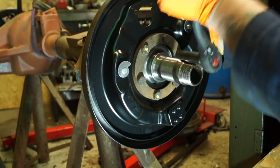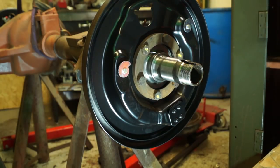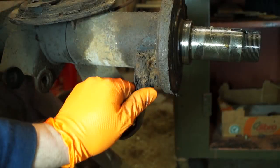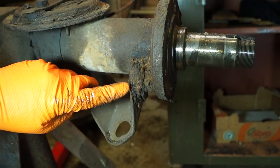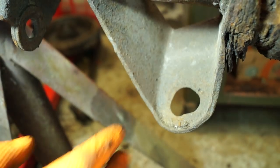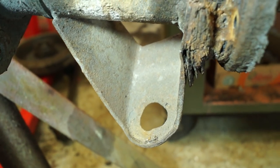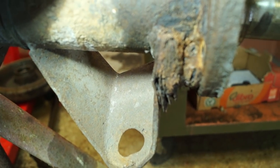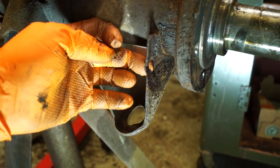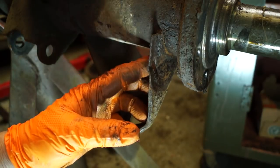You can see I've marked them — just pull them up, nip them up, and then torque them up. What you'll see is what has been shaved off as it's been pulled onto the stub axle. We didn't get away very lightly here because there's puff-pastry rust and mud crammed up in this aperture. The shock absorber mount is worn so that will need replacing, and it looks like it's rotted right the way through the bracket. After I cleaned it up — yes, there you go, it's rotted right through. So this bracket is going to need changing, and we will do this once we've done the brakes.